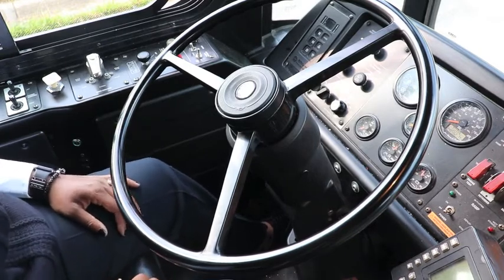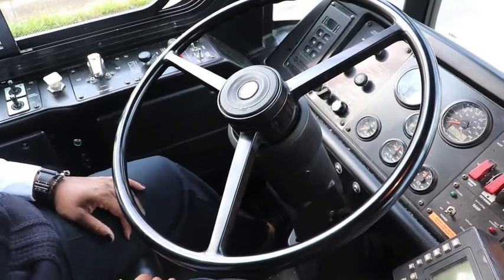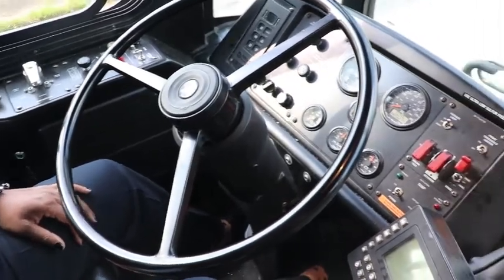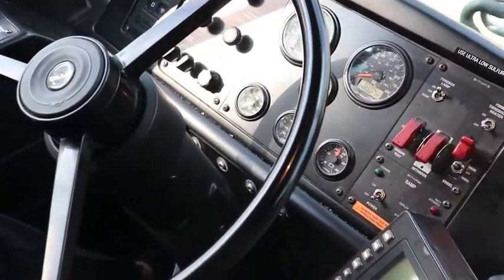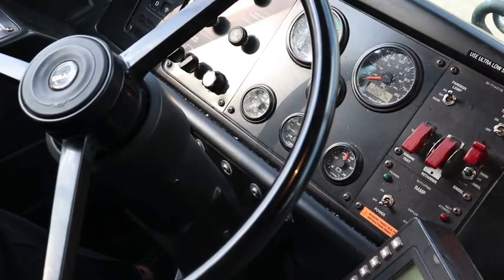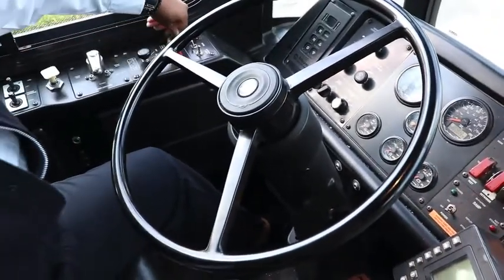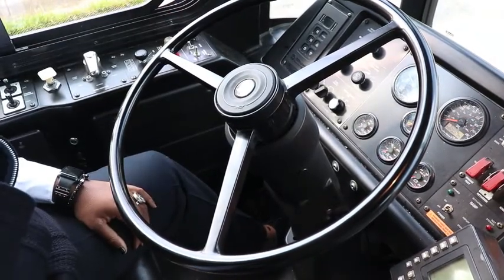After the minute is up, you're going to begin the fan. At 60 PSIs you should hear your bells and whistles and warning lights. Between 25 and 45, your park brake should pop up. Park brakes have popped up — that means that your four-point air brake test is complete.